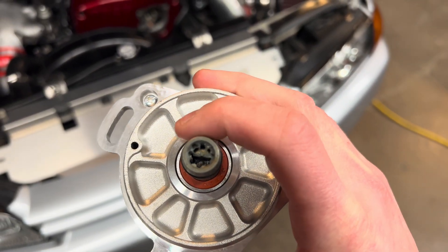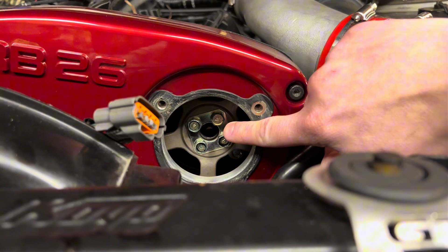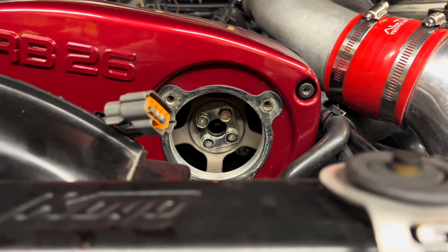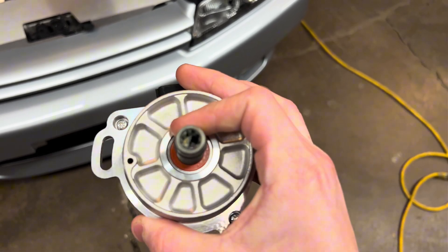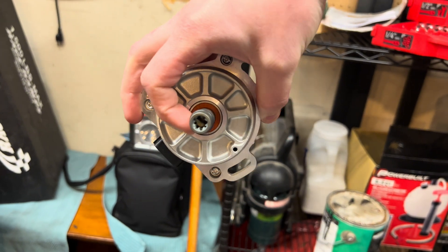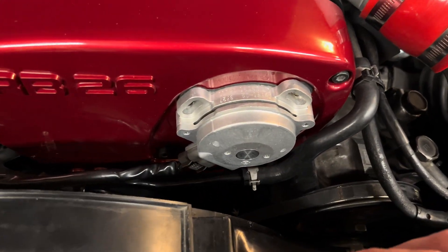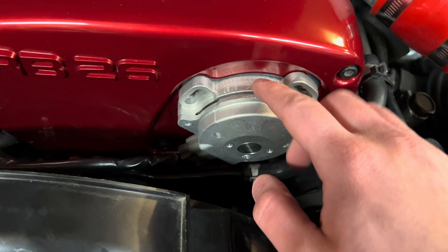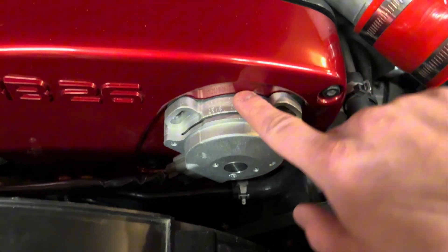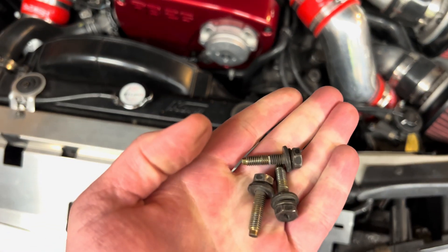The process is really easy. You can see this little groove inside on this side, and you can see the cam gear key right in there. What you want to do is line that up so this piece will slide in — the key is actually aiming up, so move it down and you'll be able to slide it right in. It's a little bit of a tricky process lining up the keys together, but once it's flush against the timing cover you're good.